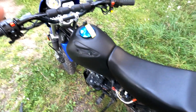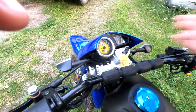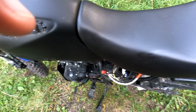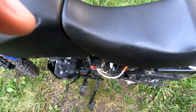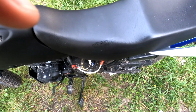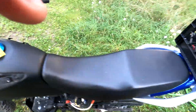Alright. First diagnostic procedure. Turn the ignition on with the wires. Alright. The negative battery terminal was sparking and then it came on. The negative battery terminal is loose. I have not touched it since I purchased the bike, but I know who put it together.